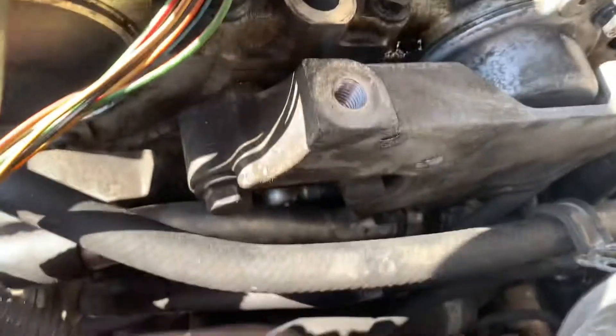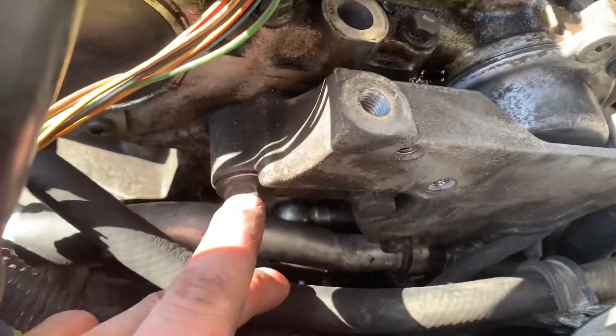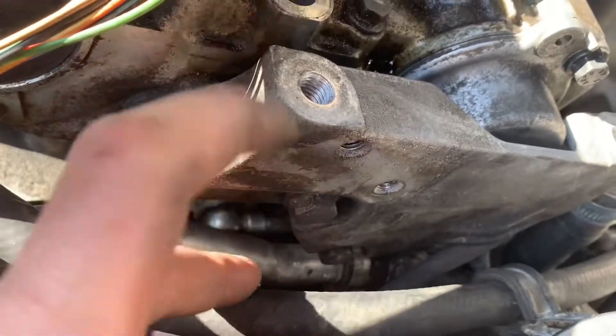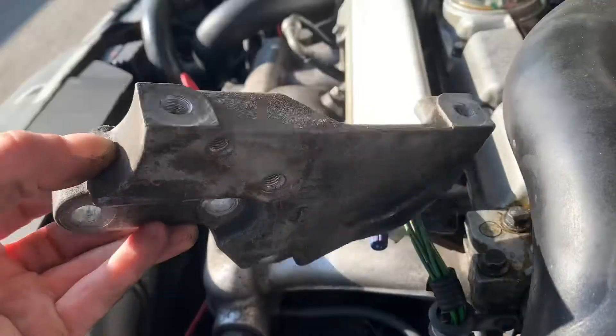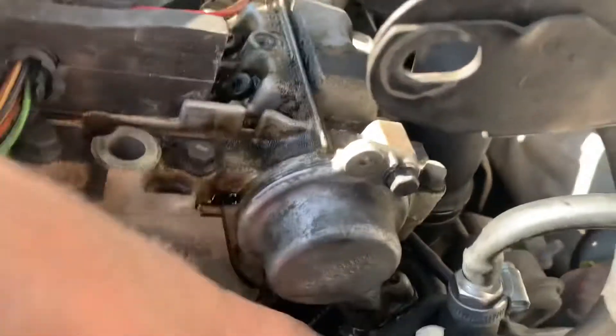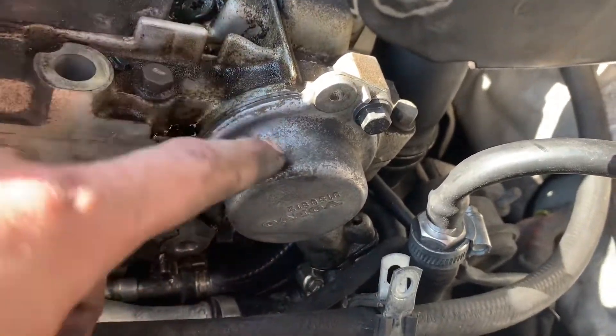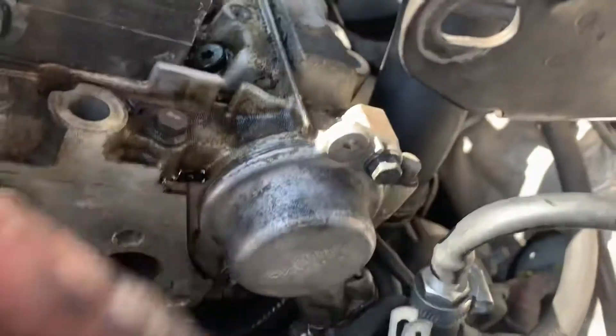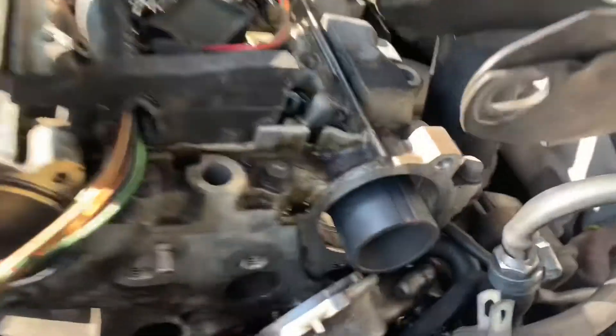You need to get this bolt, this bolt, and this bolt — three bolts. After a bit of wiggling it should come off, giving you access to this little cover here. It's the cam sensor, so be careful you don't damage it. There's a bolt underneath and one up top — I think that's 10mm as well.